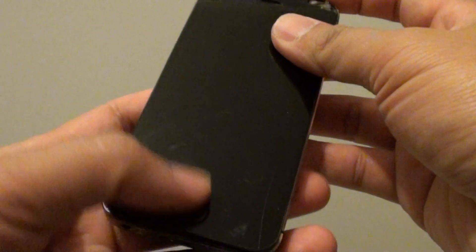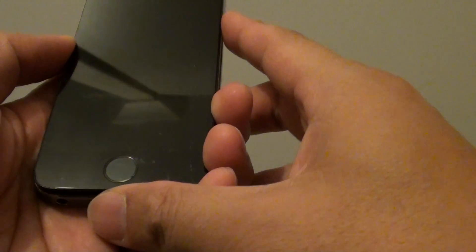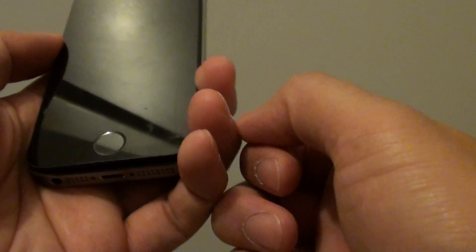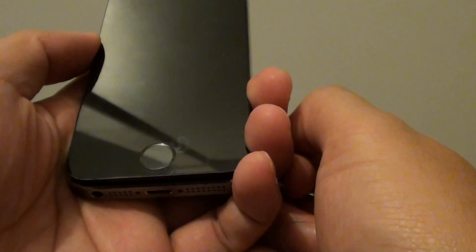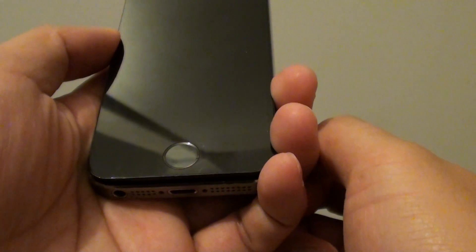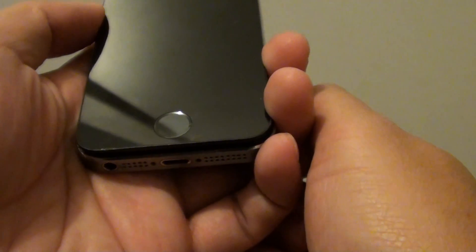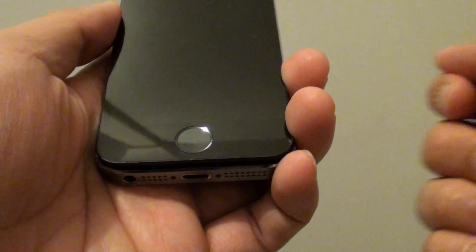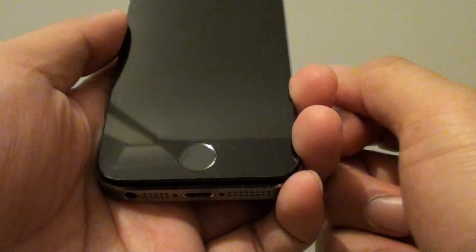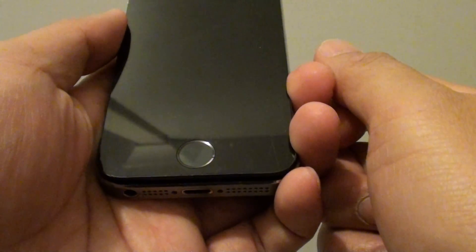After checking the phone reset, the cable, and the adapter, the next thing to check is if you are plugging your phone into a computer. Make sure that the USB port is giving out power and is still working — try plugging into a different port. Preferably, plug directly into the motherboard, so if you are using a desktop computer, plug it into the back. If you are using a laptop, plug directly into the laptop. Do not use any extensions that add more ports — always try to connect directly to the source.